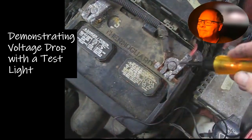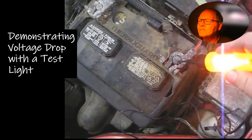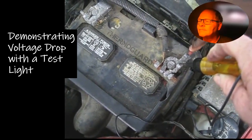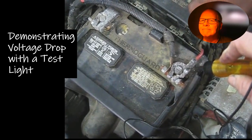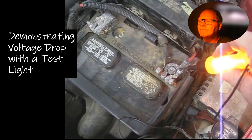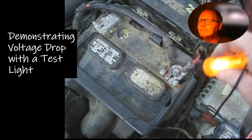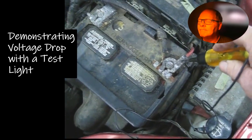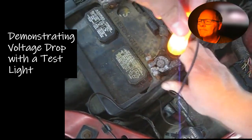What's wrong with that picture? The power is supposed to be coming in here. Grab that battery terminal and twist it a little bit on that post — just like that. See that? We've got power now. Try to start it. It went dark again. You ever seen that before? That happens all the time. Grab that light — hold that light right there. This is something fairly common — I'll move that terminal. Try to start it again.